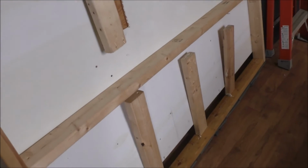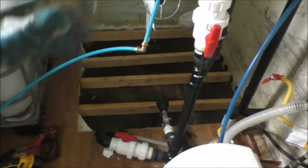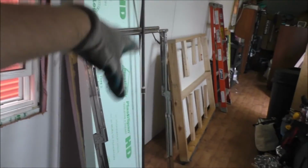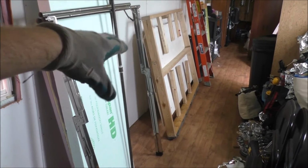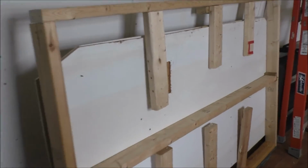Okay guys, so what I'm going to do is take my bed frame and steal some of the plywood off of it. You can see it here. Steal about half of that, and that is damn close to 3/4 inches, I believe, because it's just layered 1/4 inch pieces or 1/2 inch pieces. So I'm going to cut it down to the size I need for back here in the subfloor, and it doesn't have to be perfect, it leaves a little breathing room for any water that does get down there and sits in there. We'll cut that to size, then I'll take it outside, coat it with the polyurethane, wait 12 hours and then put it down in there, and then we should be good to go. So I'm going to get ahead and start doing that.